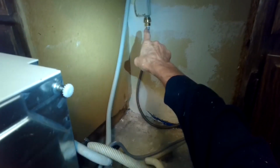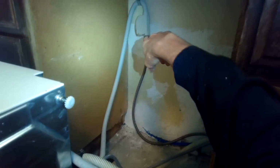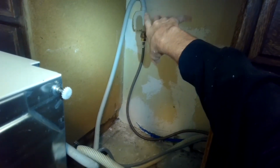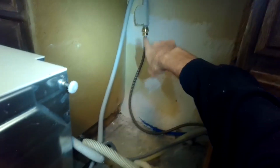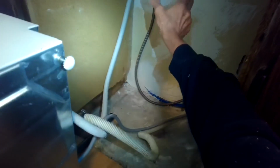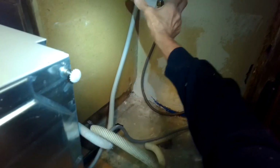Just so you guys know, for the Miele, it's good to have the fill valve up a little bit higher, as we see in this case. You usually have to replace these pretty often for customers. For us, though, this one's been in here for years and years and years and hasn't failed. So when you think about installing yours, I think they recommend actually that it's on the horizontal plane and that it's up a little bit higher like this.